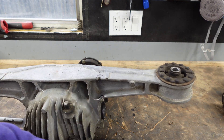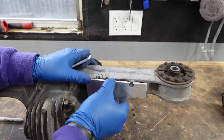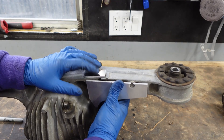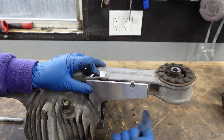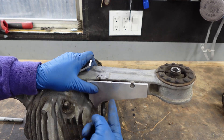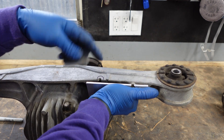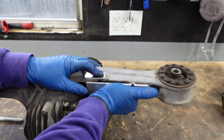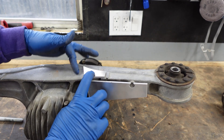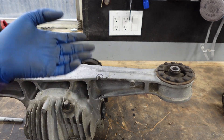What I'm going to do is show you how to weld these on. You can see this has a hole here for this nub, and once I clean it up it'll fit on there. Then this weird-looking plate sits up top here and you weld all the way around. What I do is put this plate on first, fully weld it out, then fill in the top and bottom holes. Once that's done you can grind it down so it's smooth, put this on top, weld the two together, then run a perimeter weld around this piece. You end up with a super rock-solid diff arm that will not break under aggressive driving or high power.